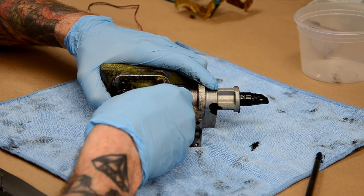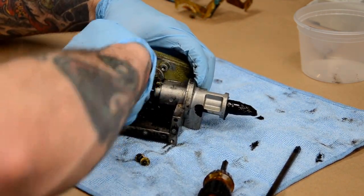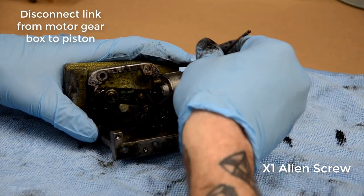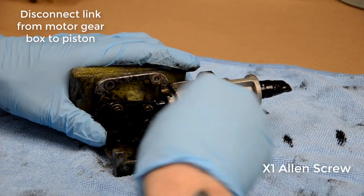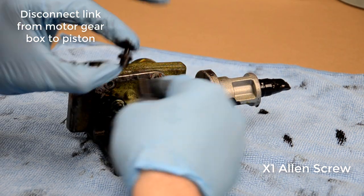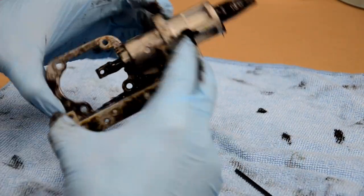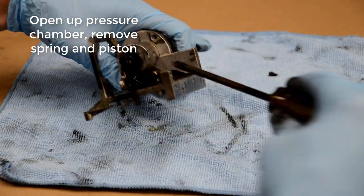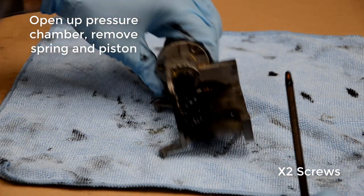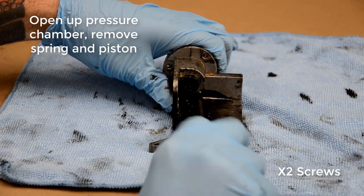Again, another stuck screw. And I put all these really inky parts, so the screws, if they're covered in a lot of ink, I'll put them in a little plastic tub so that I can let them soak in some mineral spirits and help break up some of the ink for when I go to clean it later. I'll mention it in some of the annotations as well, but the screw on the bottom right, the one I'm about to remove, is actually longer than the other two screws, so you need to remember that when you're putting it back together.